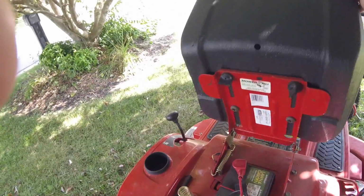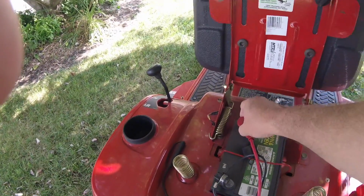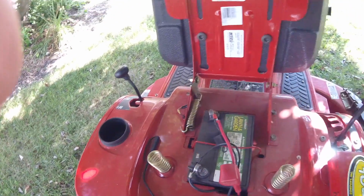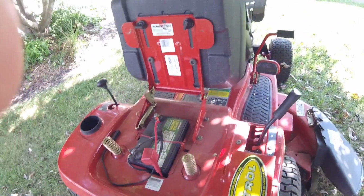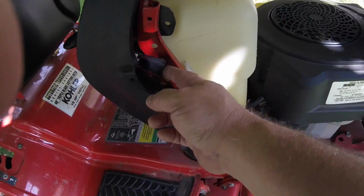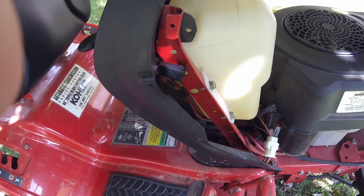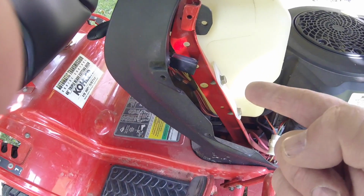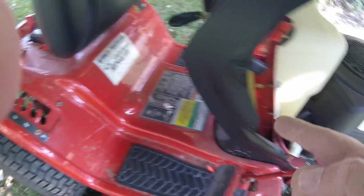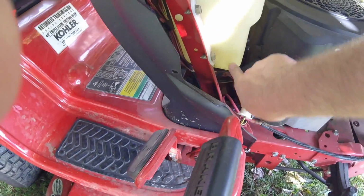While I was running here a minute ago, the 20 amp charge fuse blew, because the alternator is putting out so much current trying to get this battery up to state that it popped the fuse, which is located right in here. So I've got to get a new fuse, and I figured, well, hey, in lieu of jump starting this the rest of the season, I'll just get a new battery too. And I got to get gas. You can see we're just about out of gas.